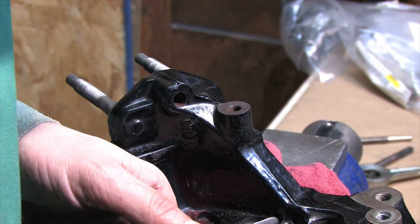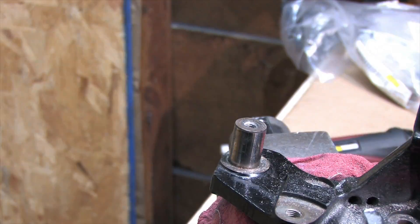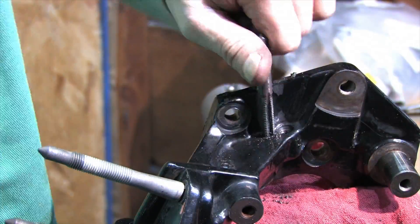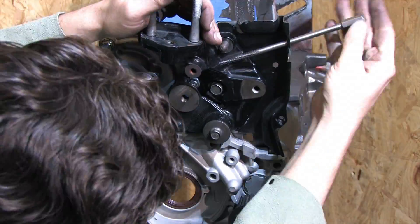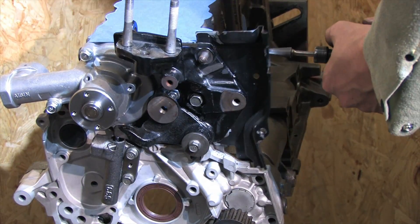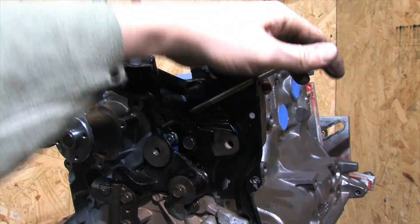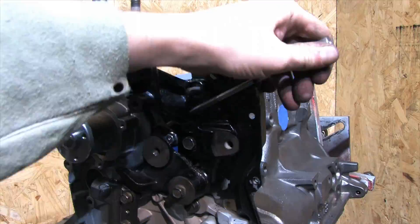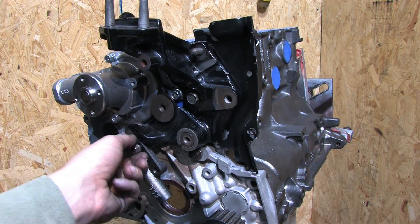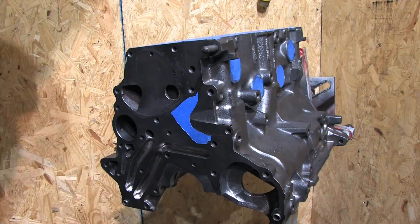I'm cutting a groove to help get a little better clearance for the tool and to help line up my approach if I ever have to use it. There are two holes now and I need to fix that — I see it as a superfluous hole that will make the tool harder to use. You could end up in the wrong hole, miss the tensioner, and hit the water pump right in the bolt. I apparently didn't get it perfect because I had to do a tiny bit of grinding to the timing cover — it interfered slightly with one of the water pump bolts. You could actually move the hole out about a sixteenth of an inch so the tool lines up more on the outside of the tensioner arm, but since it's too late now, I'll just make room for it instead.